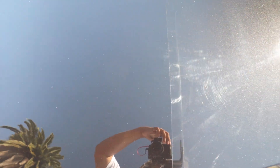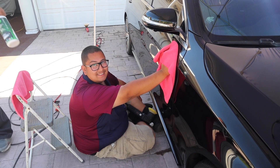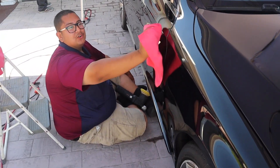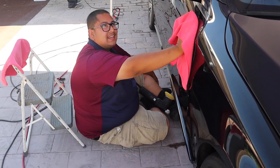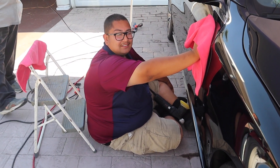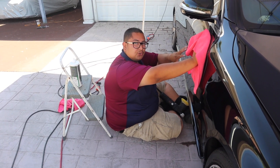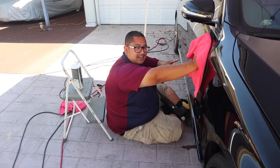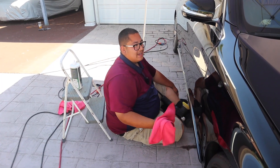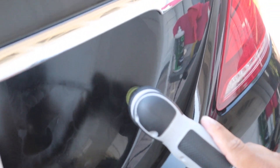That's the only reason why I kind of don't like working under a canopy — but that's where the light stands come in, LED, even your flashlight, it's not the best. But I can already tell it's clearing up. I put the tape over there on the hood so we can move the canopy and compare it. We're going slow — not as slow as we would for a polish — but the paint's already clearing up. You can tell the difference because it looks a little more clear. When it's oxidized it looks cloudy, and it doesn't look like that anymore. These two doors are done; I still have the quarter panel, the back one, the mirror, and I'll bust out my one inch polisher for the tight areas.